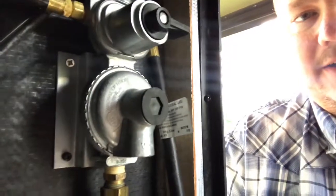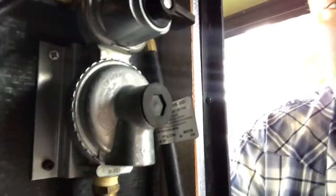I've got plenty of tape around all the connections. After I get them all hooked up and the regulator mounted in place with the screws, I'll spray some soapy water on it so you can see what it looks like when you're testing for leaks. I got all the hoses hooked up — you can see the regulator in there. I also added an extra fourth screw that Grand Design apparently didn't think was needed, but I kind of did. So now it's got four screws, two on each side.